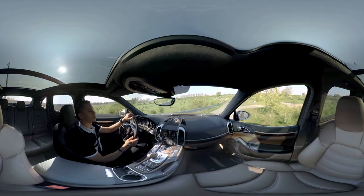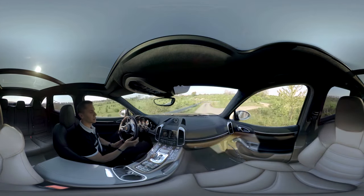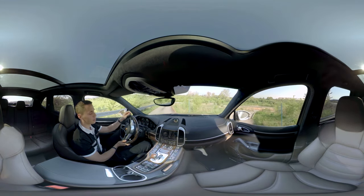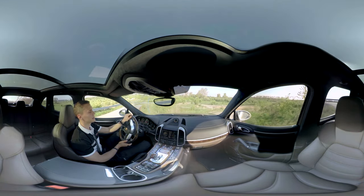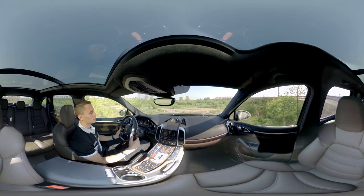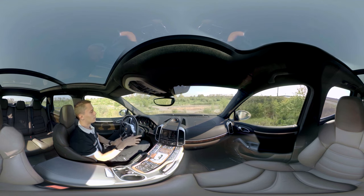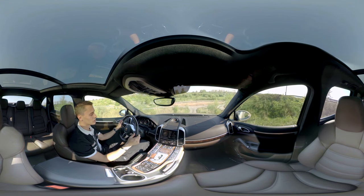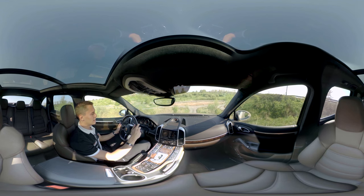We're also using the Porsche Hill Control feature here. Information in the instrument cluster indicates that Porsche Hill Control is running in the background. We start to roll along the gradient and position the car on the gradient, remaining stationary. The system specifies a starting speed of 3 kilometers per hour, or 2 miles per hour, and it works at speeds from 3 to a maximum of 30 kilometers per hour, or 2 to 20 miles per hour.